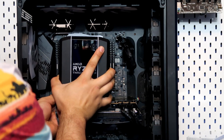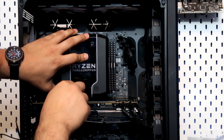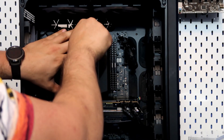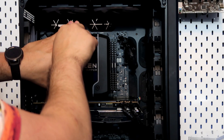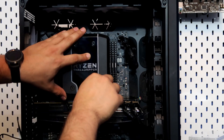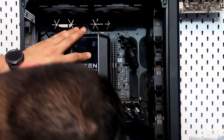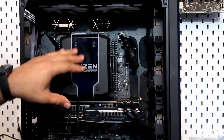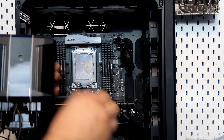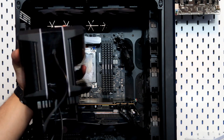Not too bad at all — just lining up the holes. Now we have a lot of room for RAM clearance, no issues at all. We're going to hold it sturdy and start with the screw right over here, tightening it just a little bit so it can hold, then going across to the next top one. We're pretty much making a figure-8 pattern on this Threadripper CPU cooler. But before we do that, let's make sure to attach the USB cable — that would definitely have been hard to get to with the big GPU in the way. Let's put that in place.